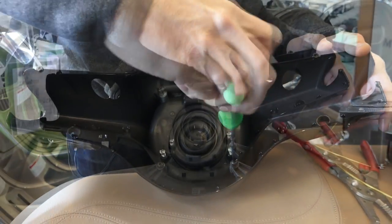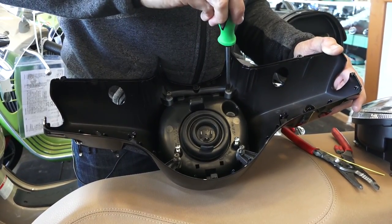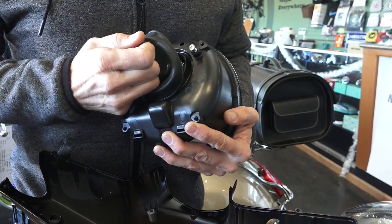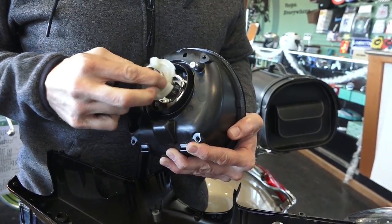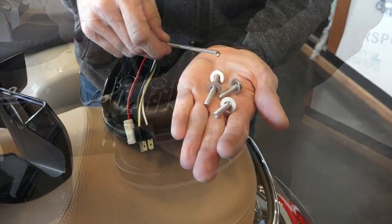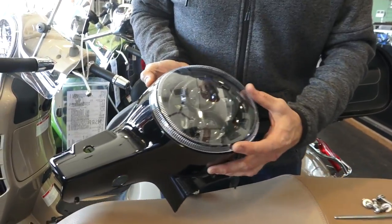Go ahead and remove all four of the Phillips screws. Rest the headlight on the seat — a good soft surface that will not scratch the plexiglass lens. Give it a small push and it will drop right out of the handlebar covers. If you're changing the bulb on the standard headlight assembly, there's a rubber cap, a bayonet-style ring, and then the bulb pulls right out. On the new headlight assembly, go ahead and remove all four of the new stainless steel Allen fasteners with the 4mm Allen driver. The four included screws are all identical length and include a pair of washers to lock them in place. Take the headlight assembly and fit it into the handlebar cover.